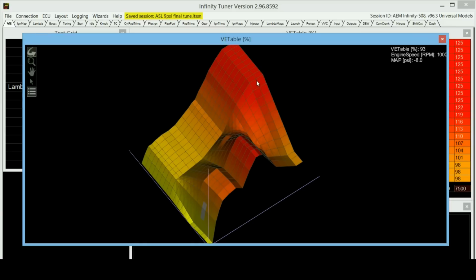So that's why they're going to reach their peak efficiency at an earlier stage compared to the engine speed. And the same with the supercharger, actually. When you put a smaller supercharger pulley on a supercharger, then you're actually taking that peak efficiency of the supercharger to a lower engine speed. So you'll basically improve the flow at a lower RPM, but you might not make too much of a difference